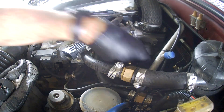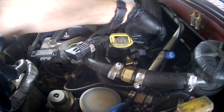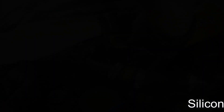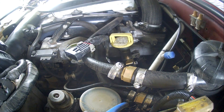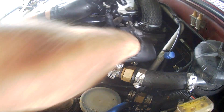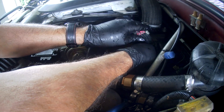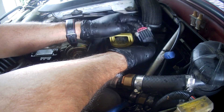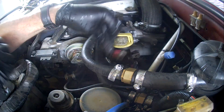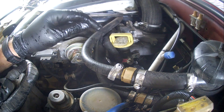One of the things is the green seal around there. I've just sprayed that with contact cleaner, so the seal would not be working as well as it should. Normally I would use a rubber rejuvenator on it, just put it around the seal to give it a bit of rejuvenation. But I've put silicone grease on instead. Make sure you assemble this the correct way around — make sure the seal goes into the hole as you can see. You can see the seal's gone in there on both sides and it's clicked together. And that's it — we've now cleaned out the injector harness plug.